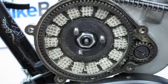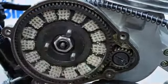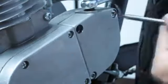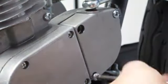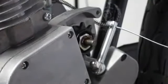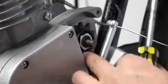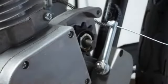You'll notice that if you spin these 3 pegs that the drive sprocket will spin as well. 3. Now remove the clutch case cover. Let it hang in place once you removed all the screws. Doing this exposes the 10-tooth sprocket, and exposing the opposite side makes it spin freely for an easier installation.